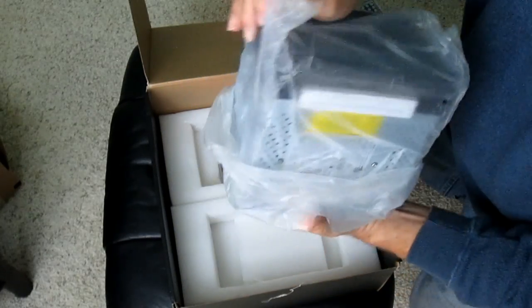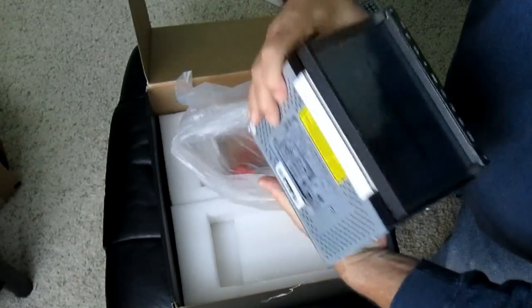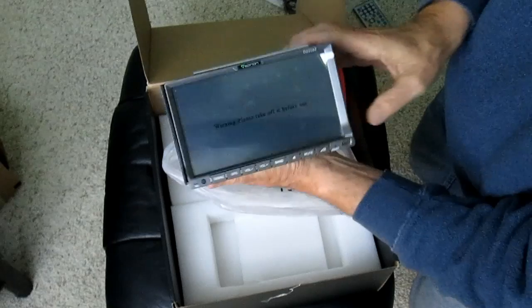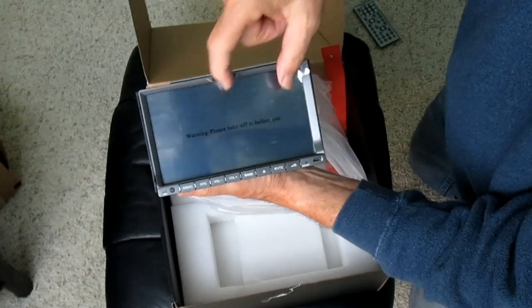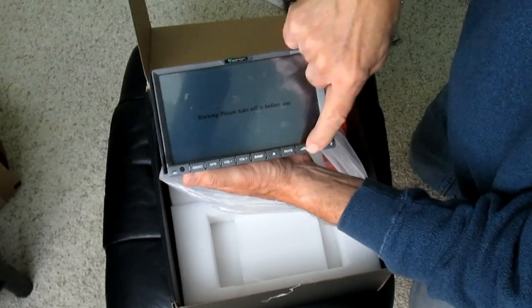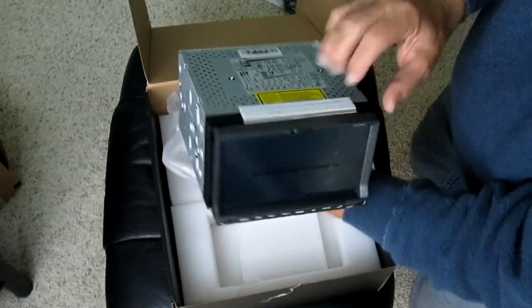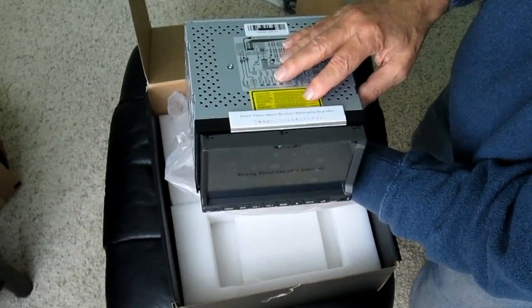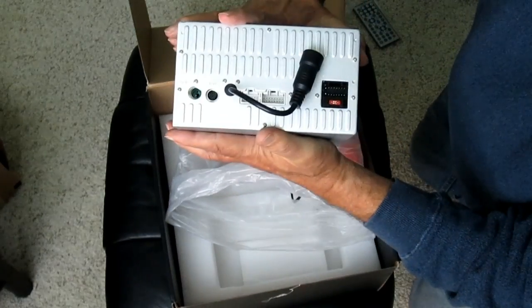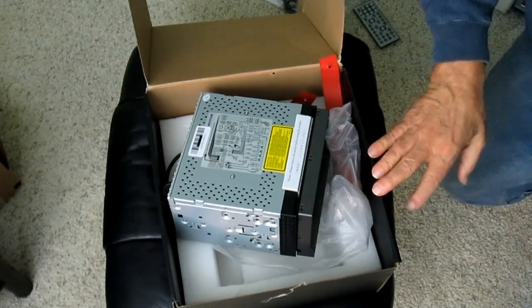Remove those straps temporarily — don't forget to take the screws out later. Taking the bag off, we can see the screen, which has a protective film on it as usual. It's got all the buttons at the bottom — a pretty nice layout that allows you to have both touchscreen capabilities and mechanical buttons to control some functions. There's also a microphone and an external 1394 interface. The rest is a standard double-high DIN installation, so it'll fit nicely in your car. Familiarize yourself with your stereo system and read the instructions before you start the installation.